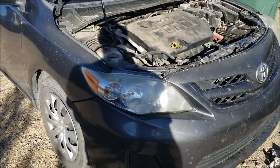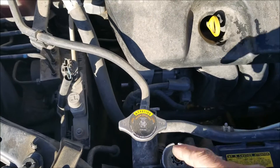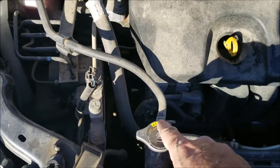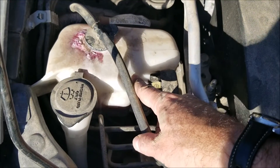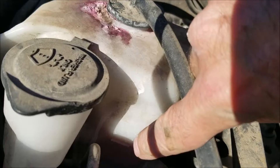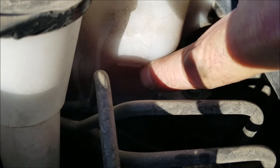Hello all. I'm on this 2012 Toyota Corolla and I was going to check the radiator fluid, so I thought I would show you how to do it real fast. This is the cap for the radiator, but this is not where you check it. You check it right here at this overflow fill bucket, and if you look down here, there's a line right there where it's supposed to be up to.